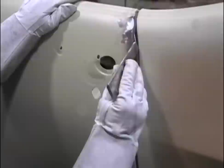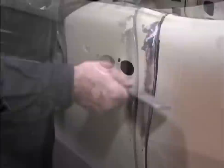Use the gauge and a marker to give the rough shape of the door, then use a file to keep shaping the edge. If we hadn't done this step and just filed the door skin, we'd eventually go through and split the skin. We've now got a proper gap that will last forever.